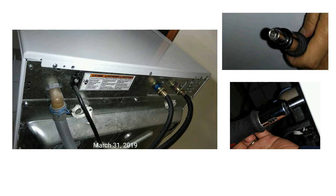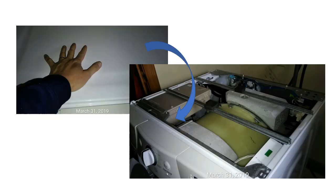First thing first, you need to take the upper panel off. What you need to do is remove three screws out here — they are quarter-inch size screws. You can use a multi-bit screwdriver, just use the head and turn them and they will come off. Most of the screws on these washers use quarter-inch screws like this. After you take the three screws out, put your hands on top and slide the panel to the back. The upper panel is off — that is your very first step.